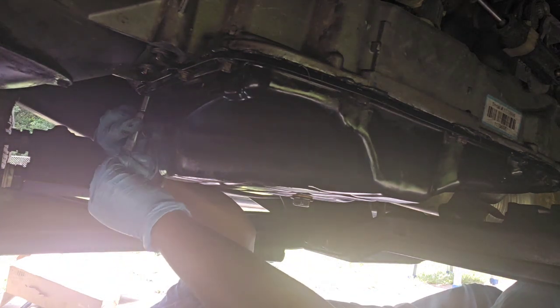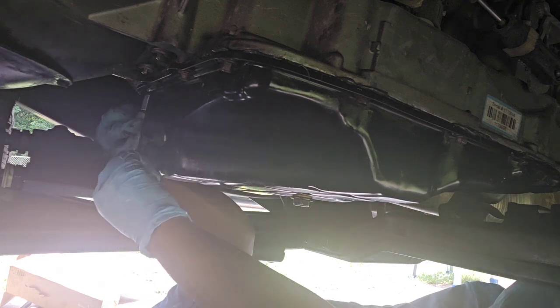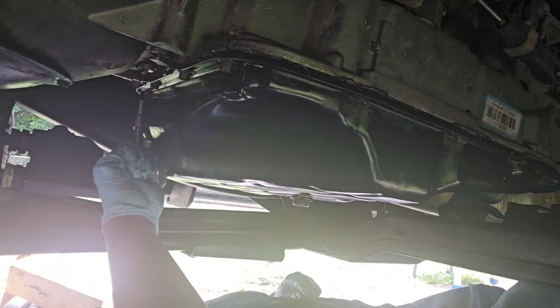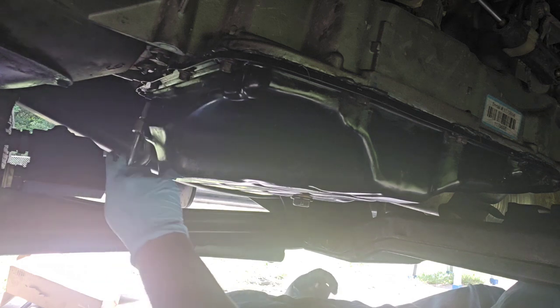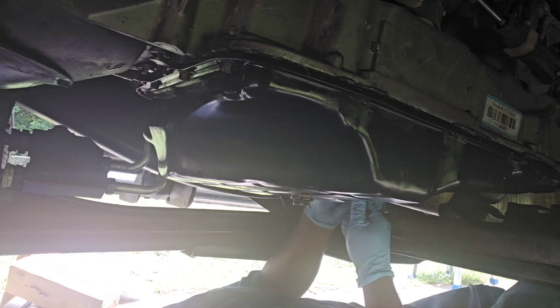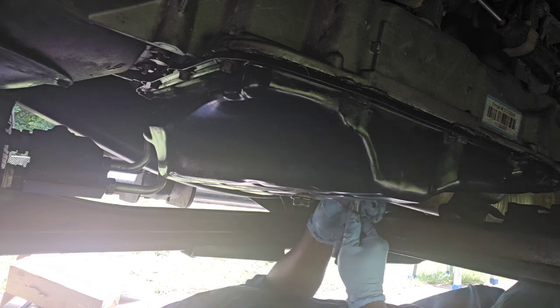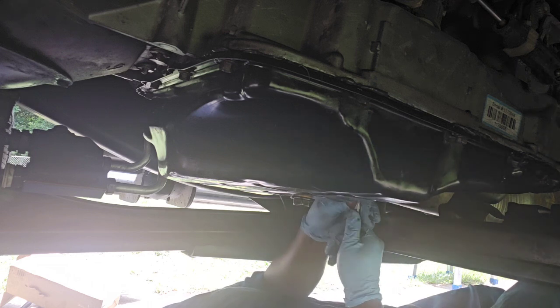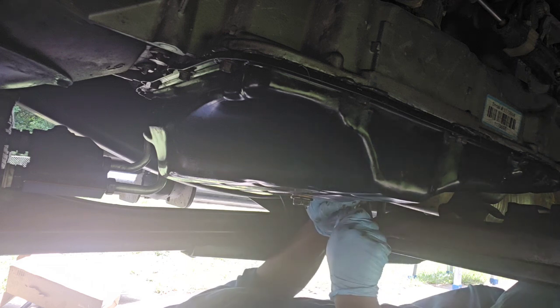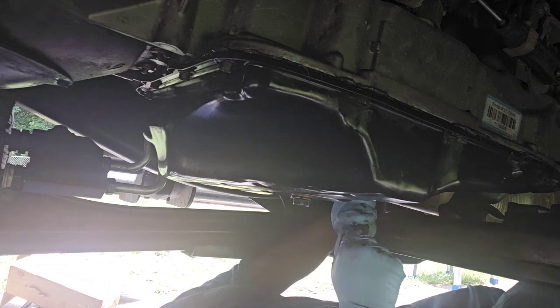And then I used the paper gasket by itself. That doesn't hold. That paper gasket doesn't hold. So I had to drain the fluid again on that one, and then I used the silicone. Didn't have no issue since. But I noticed when I put this pan up there, normally when I use silicone, I just stick it up there and get everything in one go, but I kind of stuck it up there and pulled it back down a little bit, so that kind of flattened out everything.